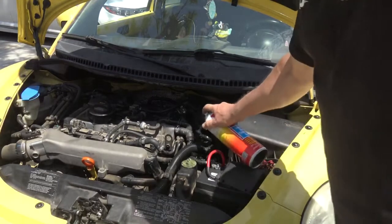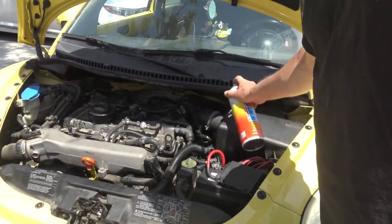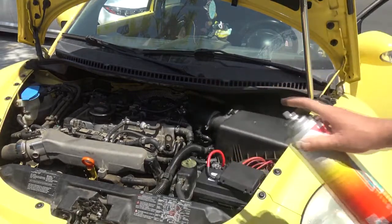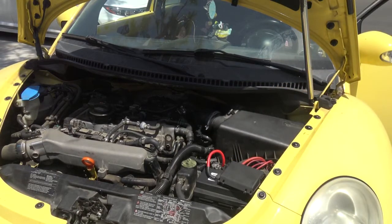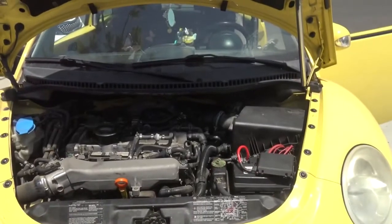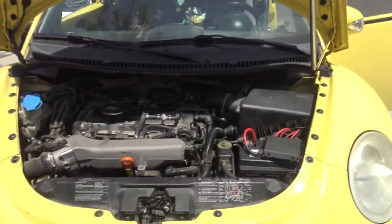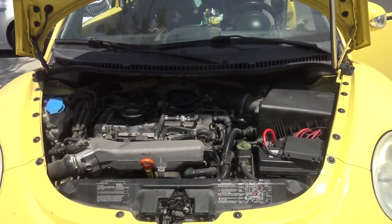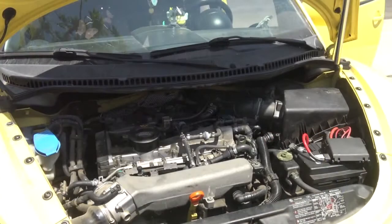That's how you check. It's going to smooth out and then go back to a rough idle. We'll see if we can fix that booster line and check if that fixed the brakes, or if it's a master cylinder issue. Now to tear it apart.